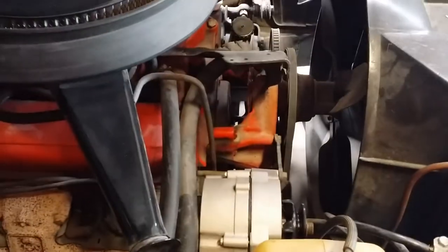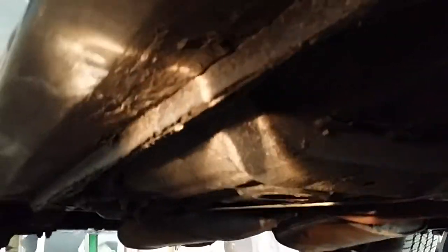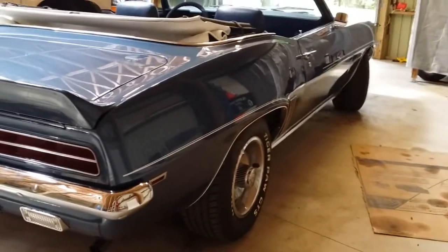I'm assuming that's a typo, but it was 1969 — we all know what went on in 1969. The engine bay is unrestored but still in really solid shape. Interestingly, it's a drum brake car. Power steering, no power brakes. The radio has been swapped out but the hole wasn't altered. 350 trans — we didn't do a hoisted inspection today so we didn't check the numbers on it, but the pinch welds on the rockers look really nice for an original survivor. The subframe bushings appear to be original, never pulled out or replaced. 12-bolt rear end — we didn't decode that either. Overall, it's a great-looking survivor.